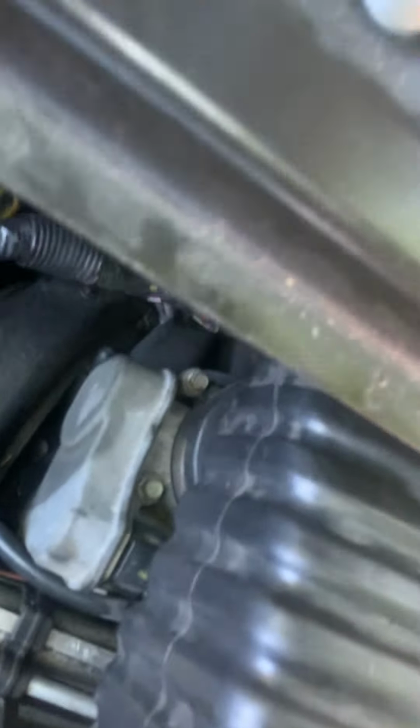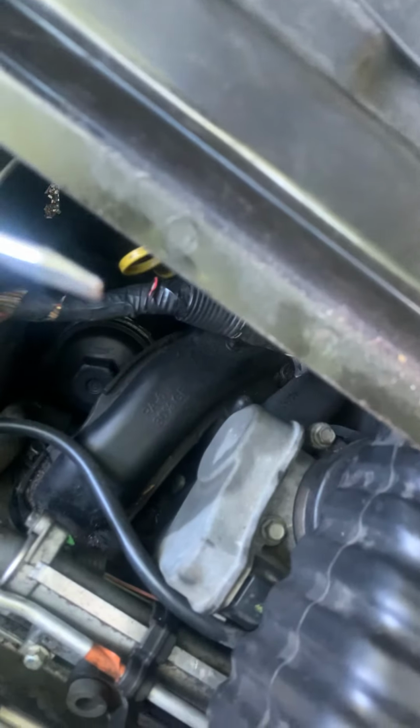And then now we're gonna take our flathead screwdriver. Take our flathead right here. We're gonna go right on down up under there to the little silver pointer. Let me show you guys. Okay. Right down to the silver pointer, and we're gonna turn that clockwise to loosen this air intake. Put that up, and then we're gonna just grab from here and pry up.